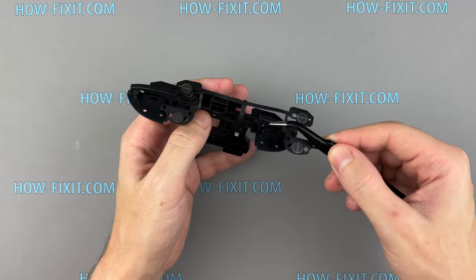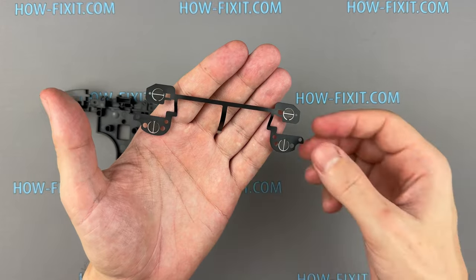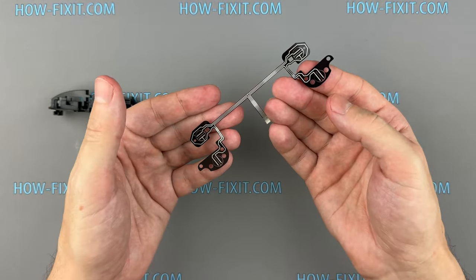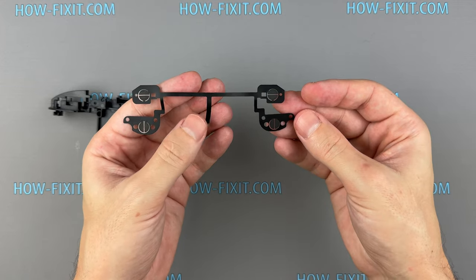After cleaning the contacts, if the buttons still don't work, this black contact coating on the film may have stopped transmitting a signal when the button is pressed. To fix this issue, you need to replace the conductive film. In the description, I've left a link to the replacement conductive film for a Nintendo Switch Pro controller.